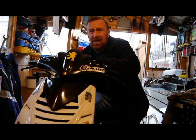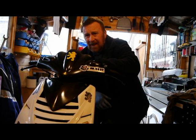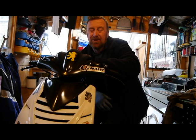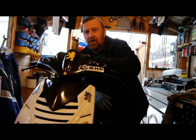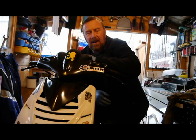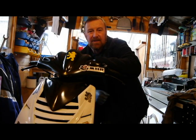The plug was really, really dirty but not that old, so I cleaned it and stuck it back in. The air filter was fine. I didn't do the carb on this one, though I always say service your bikes first — which is a must — do that first then look at other things. A guy messaged me last night saying thank god someone didn't just say clean your plug — it was a roller's clutch. I've not often had where the clutch is jammed like that, but all that rusty looking colour — I had to look at it and there you go, I found it myself.